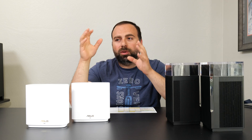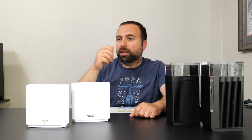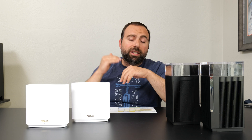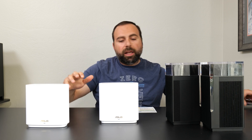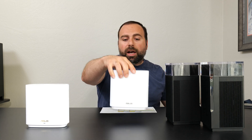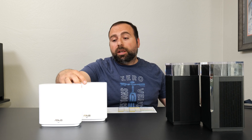Jumping to the wired backhaul setup, the Wi-Fi 6E speeds on the ET8 drop to right around gigabit speeds. The reason is the ET8 has only one 2.5 gigabit port, so when it's hooked up to my speed test server, the outgoing port is gigabit and it automatically caps the speed. When I test from the secondary node, even though it exits via a 2.5 gigabit port, it enters a gigabit port on the primary, dropping the speeds. Whereas with the ET12 Pro, because it has two 2.5 gigabit ports, speeds on the secondary node are essentially the same.